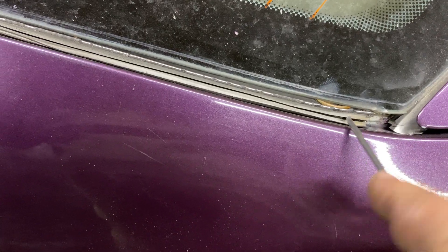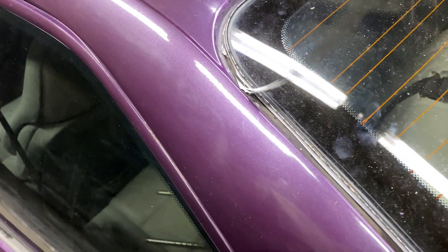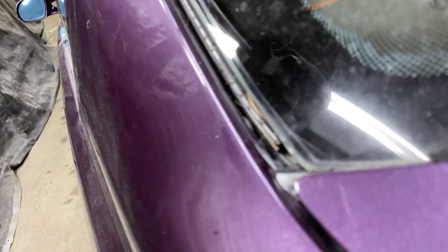Once you have a clean line, take a pick — I use a pick — and pick this side up and pull it out, just like that. I already cleared this side, so now all you've got to do is take a screwdriver and start separating it from the glass. So you've got all that room now.